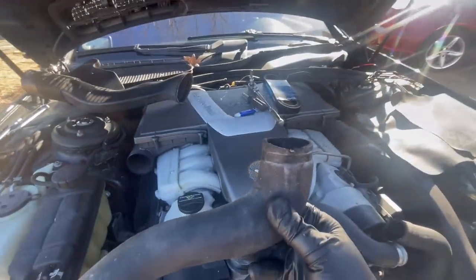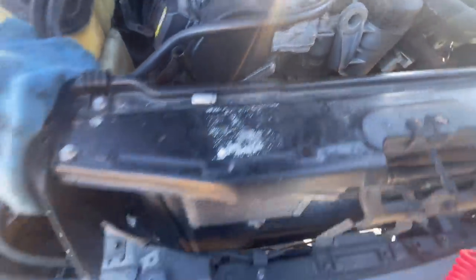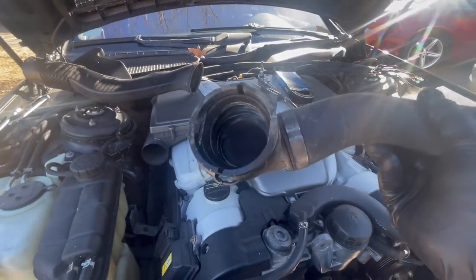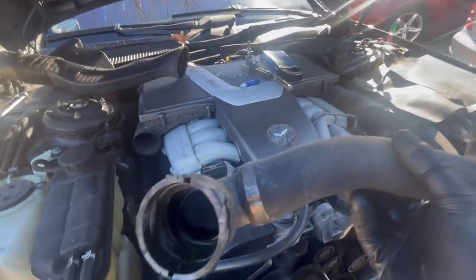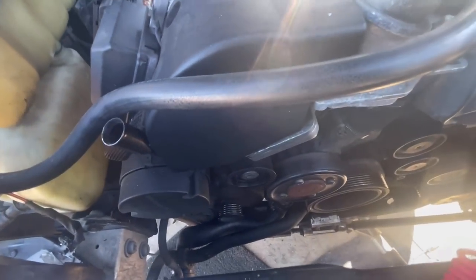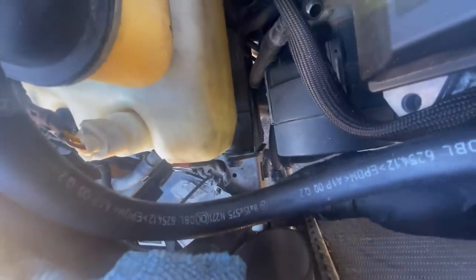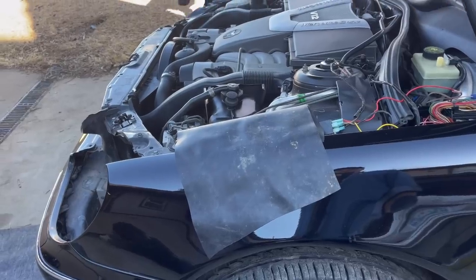That's the old one. There's a little notch that goes right down in there, a little cross to show you where it goes. This is the part that just popped off — that guy right there, I don't know why, but it did, and I don't trust it anymore. So we have the new one attached. Out with the old, in with the new. Now we're going to wrap the belt, then put the fan in, tighten everything up, put our transmission line in right here, fill it up with some antifreeze, and give her a go.